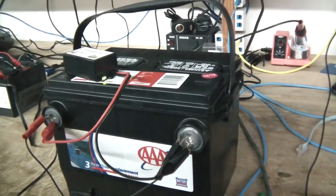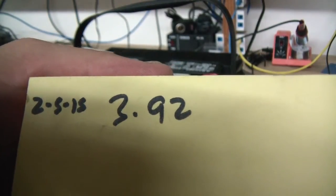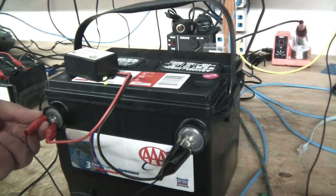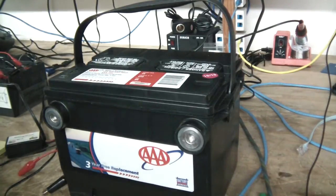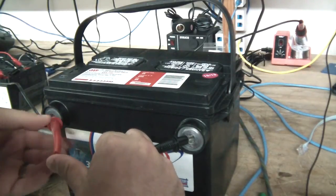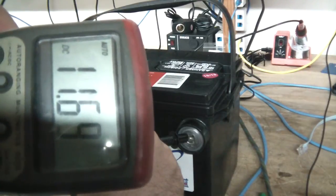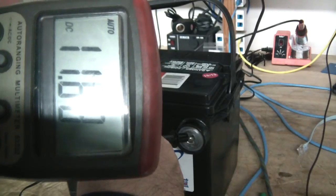I thought I'd give you an update on this battery repair project. It's been desulfating for one night. Yesterday when I tested the voltage it was 3.92 volts, and now it's the 16th. I'm going to unplug the leads and the Whizbang and hook up my voltmeter. So now we're at 11.7 volts. It's still not good enough, but I'm going to let it sit for another few days. Already a huge improvement after just one day.